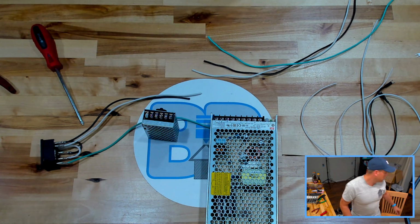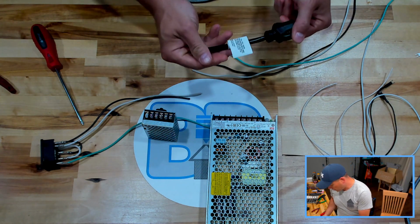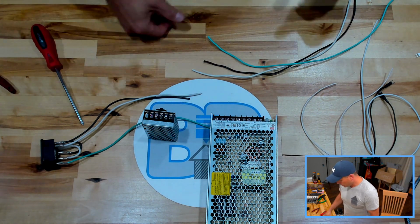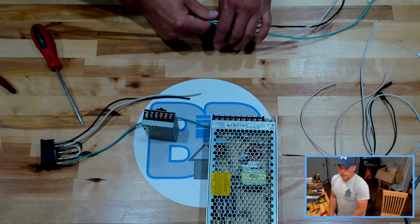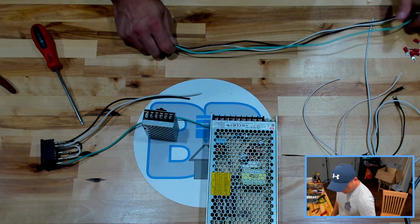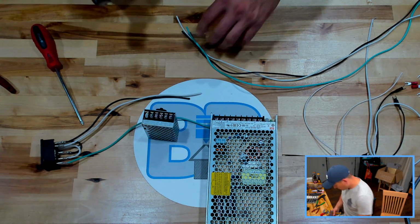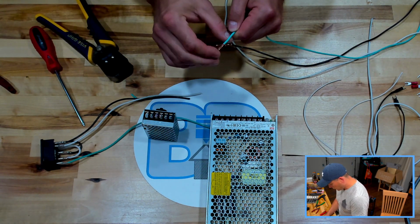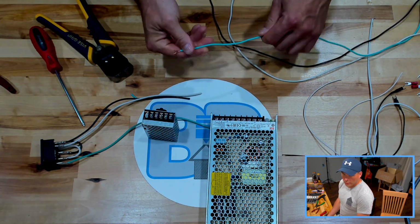Now this wire, it was cheaper to purchase a small extension cord, cut it apart, and pull the leads out. This is 16 gauge wire I'm pulling out of this. I think it was about $8 at the store, and I've got myself 15 feet of 3 conductor. Decent wire. It doesn't need to move a lot. It's not going to move a lot, so I'm not really worried about that. It does have a decent strand count on it. Let's just look at that real quick, show you. So it does have a decent strand count. It's not super stiff or anything like that. Extension cord wire is meant to bend around, get looped up, stuff like that.